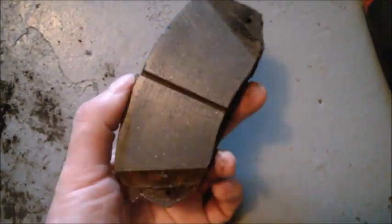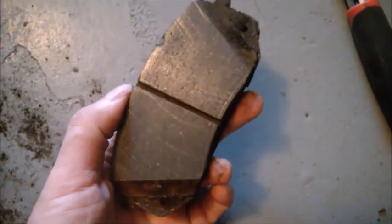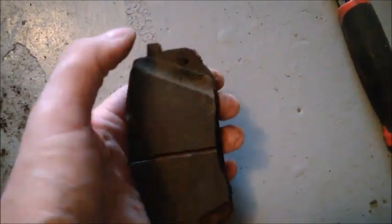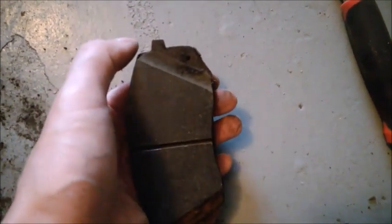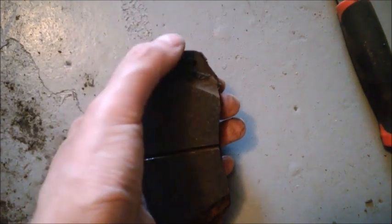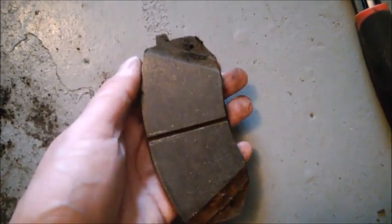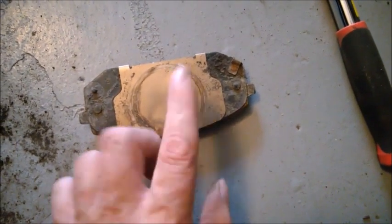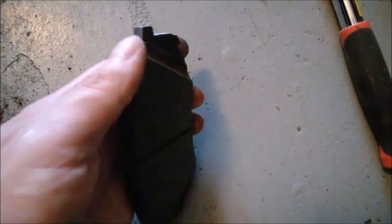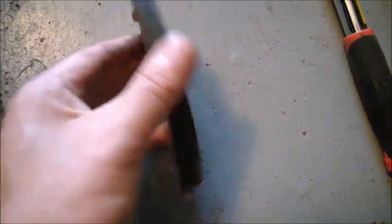This happened because when we brought the car to the Hyundai dealer, without us even mentioning it, they wanted to service the brakes - so I'm convinced they are aware of the issue. I believe it's a design problem because these are new brake parts for the year. The engineers who designed the original genuine parts probably didn't get the right tolerance, so they needed to make the part smaller so it doesn't get stuck. My guess is that 2015, 2016, 2017 and up with this part design all will have the same problem. The fix is to just remove a little bit of material - not too much. Hopefully this is helpful.